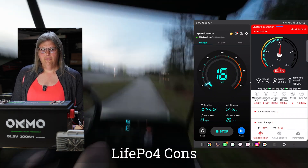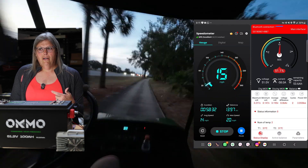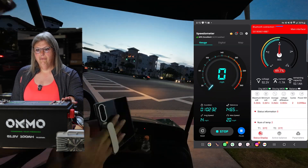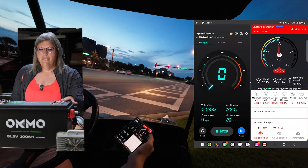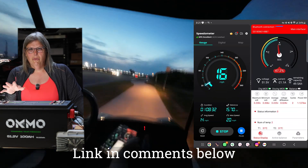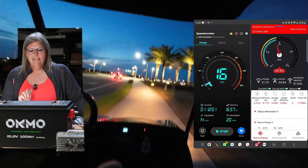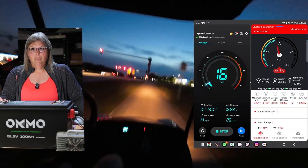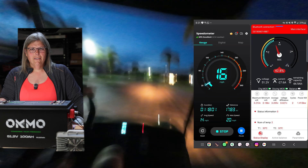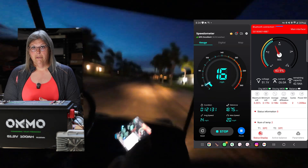They do typically come with a higher upfront cost. An eight-pack of Trojan batteries is probably a grand — a couple years ago it cost me about 800 bucks — but you're going to have to replace those two or three times during the lifespan of a LiFePO4 battery. So over 10 years, you're talking about two or three sets, maybe $3,000 spent, when if you just spend $1,500 on this upgrade you're done. I'll have a link below to the Okmo site. In the long run you're going to save money, especially if you're going to have your cart for any length of time. And even if you go to sell your cart, having a lithium battery in it gives you a higher resale value — you've already done something that most people desire in modern golf carts.